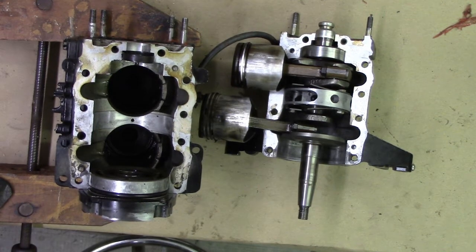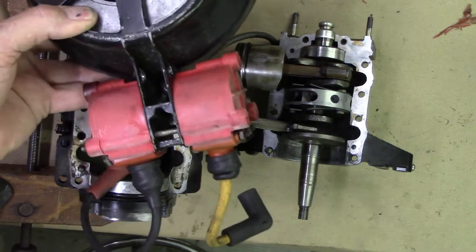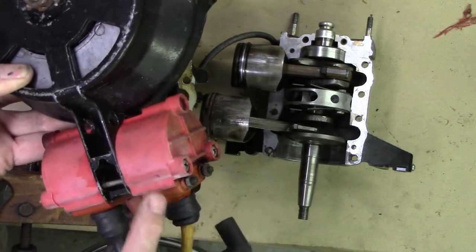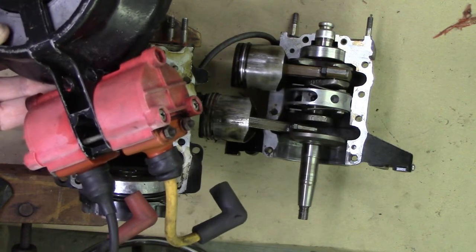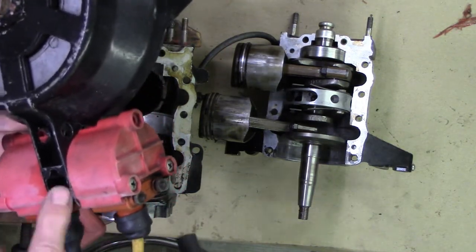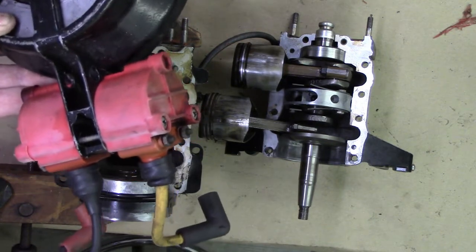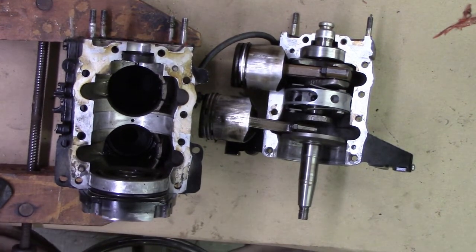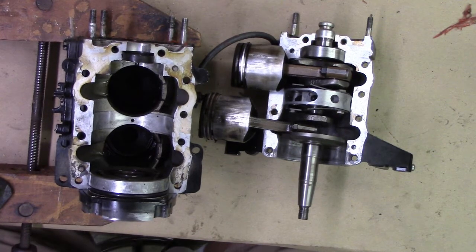The coils were okay, but the interface between the coil and the ground had a lot of corrosion, because the back of this coil has to be grounded to the engine — the other wire for the secondary side has to be connected to ground. I also discovered that the little skinny wire coming out of the back of the coil that's supposed to be pressed against the engine block was disconnected, corroded from the coil. So I dug out around the wire, exposed about an eighth of an inch of wire coming out of the coil, and soldered onto it and got it working.